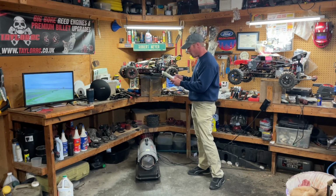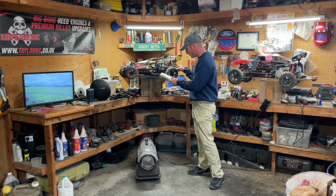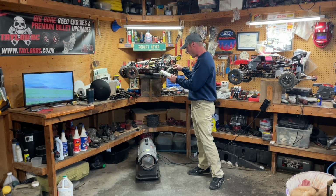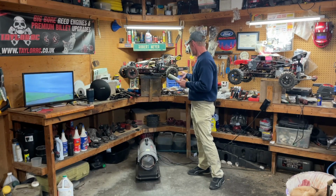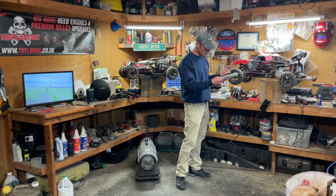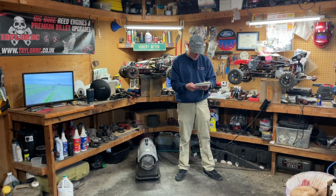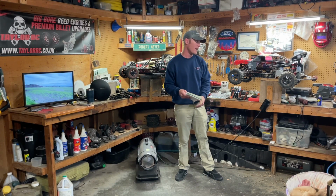So that's the huge difference. Like I said, this one's running 20/54 gears, 175 tires, and a locker in the rear. Now listen to this. The 40 is running 24/50 gears, 195 tires, and a locker, and it's not fan cooled.